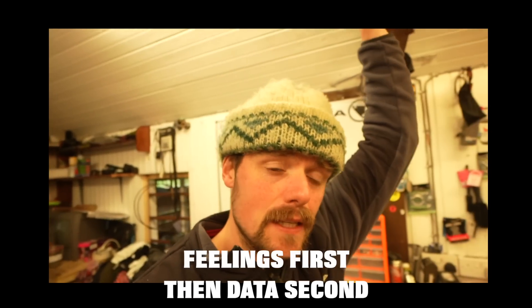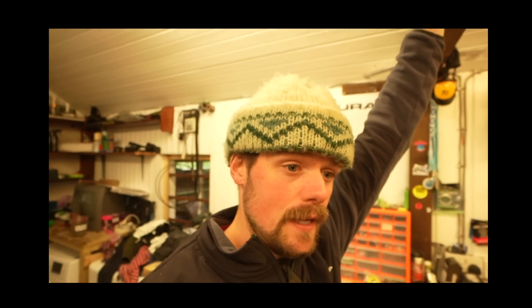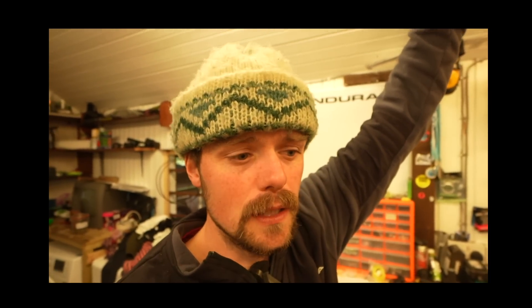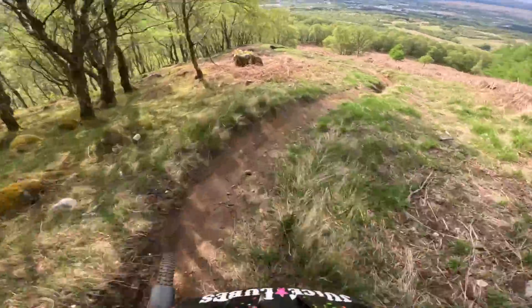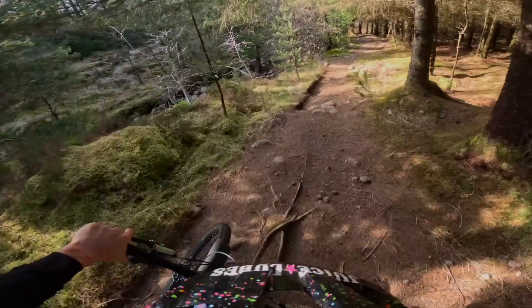Let's delve into the feels. We're going to have to take timing out of this because I did the exact same time on every track all day long on either frame. But I was riding tracks I know really well and riding them at 90%, so that's what happens. So I'm going down to feel. And the feel was quite substantially different actually for the 14.9% difference in flex. The stiffer frame was very nice at holding the line and riding slightly smoother berms - it felt like you boosted out of them very nicely. And there was a notable part on the trail, there was a little rut, where your front wheel goes around it and your back wheel would hit it.